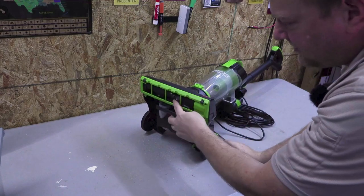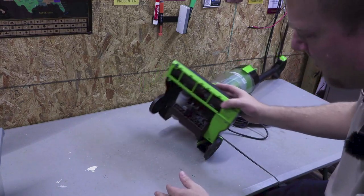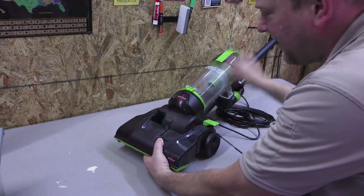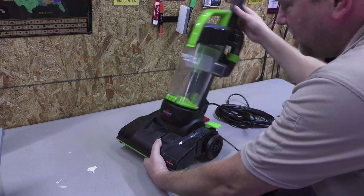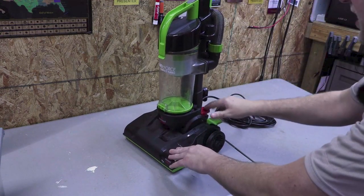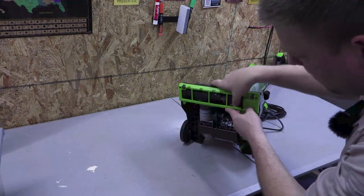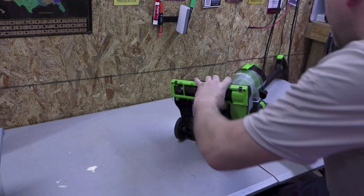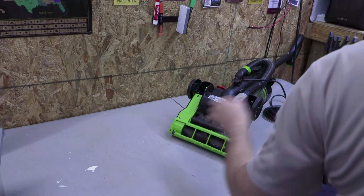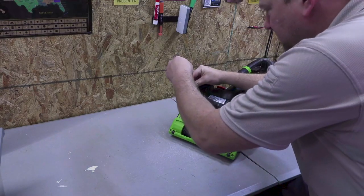So it lifts the brush head off the ground and prevents total suction on the ground, which obviously would blow up the motor. That's all that little guy does — it just lifts up whenever it's in the upright locked position. As soon as I lower it down, this little cam right here allows it to come out of its position and drop the head all the way down. Here's your on/off switch, seems to be functioning just fine. Let's check the roller head. The roller head appears to be a little bound up. These are designed to be maintained by Joe Schmo — you and me, everybody in between. Here's a number two Phillips and it appears I have five screws, so let's go ahead and take these guys out.